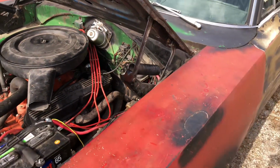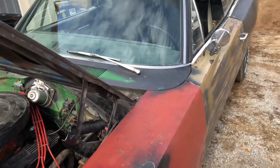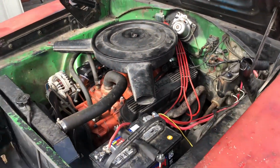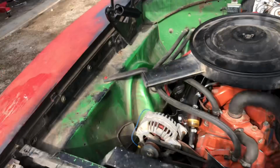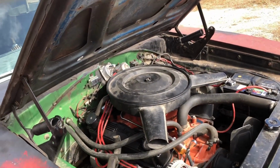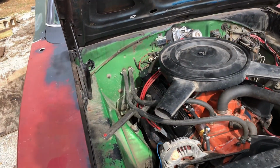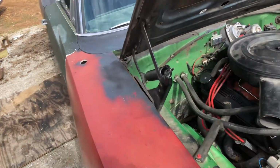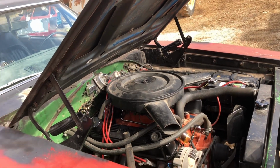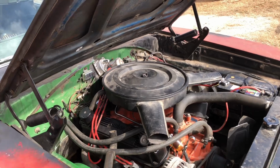When I did the tuning to it, I made it for this heavy car with a 323 gear. As a matter of fact, a little bit of a gas mileage reference: I get pretty decent mileage, and I haven't even touched anything in the carburetor, the jets. The only things I messed with were the power valve, the cams on the secondaries and primaries, and a little bit of the accelerator pump sizing. That's pretty much it of the stuff I've done. I haven't really gone into it.